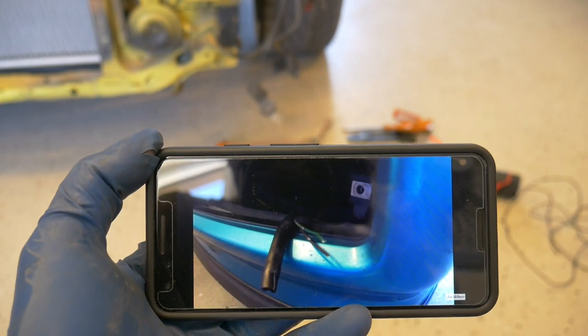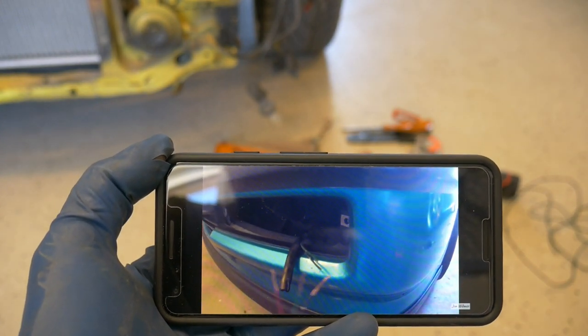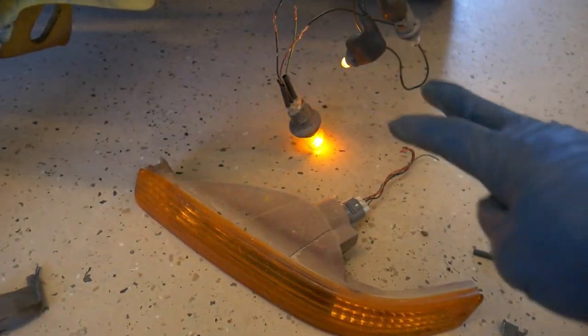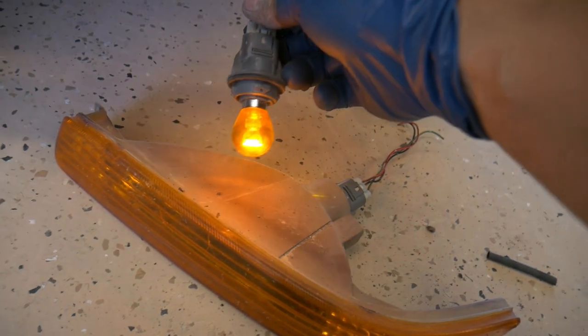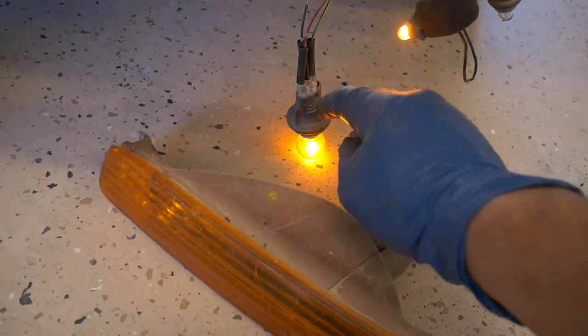Two initially coming from your Civic or CRX, black and green. Very, very simple. We're going to wire those up to the black and green on the new corner light socket. The red. I was wiring up some of the lighting. I was converting these to being a full-time running light, also blinking, using the EG corner light sockets.